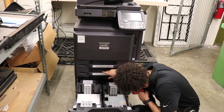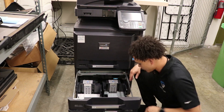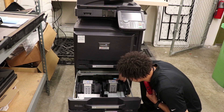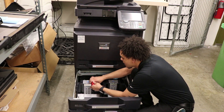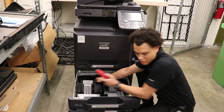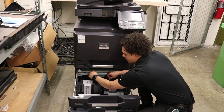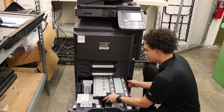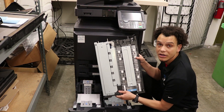Take those trays out. You could take tray two and just lift it out — it'd be a little easier to get to this screw. There's a screw right here on the left-hand side. You see B1 right here on the left that you need to remove. Really easy, one screw. There's a little metal holder — pull that out. Slide out like this and let's come over to the table and I'll show you how to change the roller.